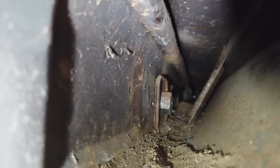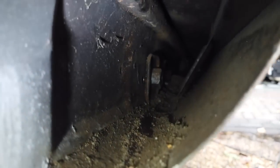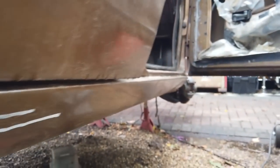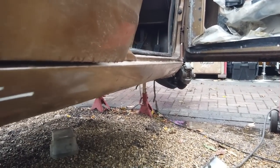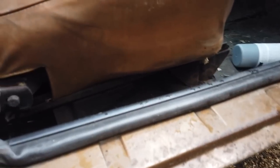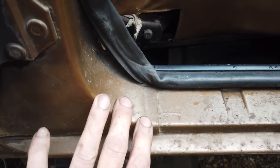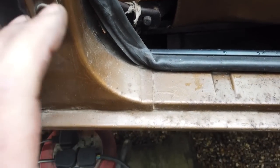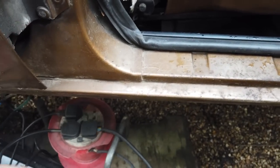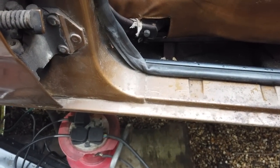Look, that's not a rot box in there, is it? That's in a lot worse than that. So I think we've cut out the rot. You can see why it wasn't really worth taking all the sill off and spoiling this lovely original top finish here, where it's basically not got any rot, has got hold. Once we get our products into here, we're going to be able to freeze this in time. So whatever rust it's got now will be locked and frozen in time to a larger degree.